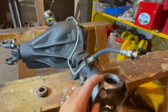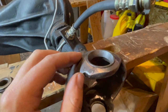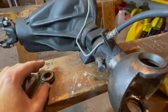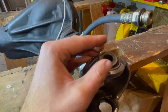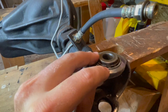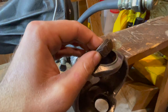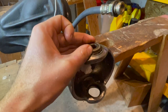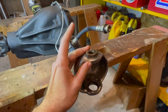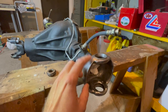I will be looking at the passenger side kingpin bearing cups, as the driver's side is the exact same thing, so once you figure out one side just copy it to the other. If we look really closely here, we can see that our kingpin bearing cup has little ridges on it, which is very bad. The bearing has little ball bearings that ride in the cup, and when it spins the grooves on the cup will get stuck on the bearing balls, creating a jerking feeling when you're turning — the bearing grabs and grabs.